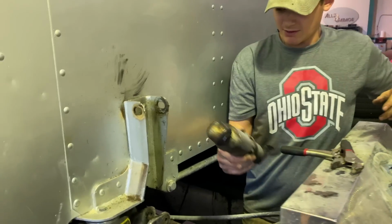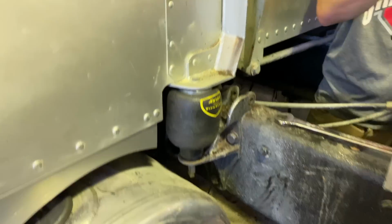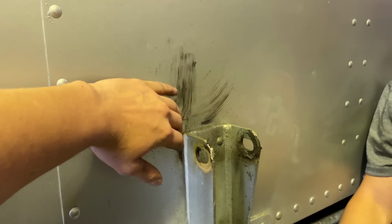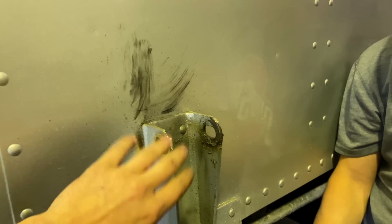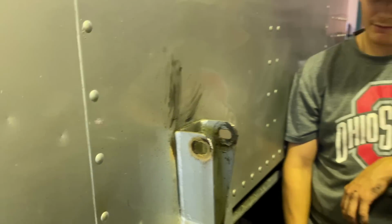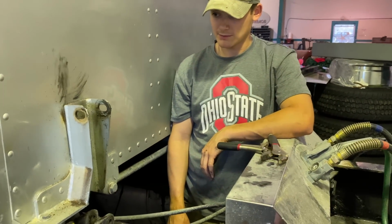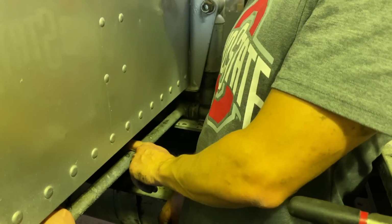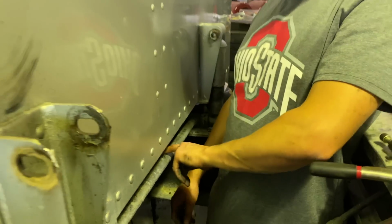Shockless. So the way that we did this is we let the truck actually just air itself up. It gives it enough clearance to really pull the pressure off the shocks themselves. This is just WD-40 and burnt shock material that we got to clean up before we put the new one on. And then we'll switch over to the other side. The other side's going to be a little bit more challenging. We've got the sway bar for the sleeper attached to the bottom.